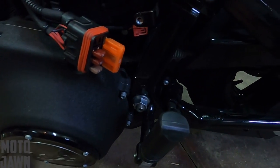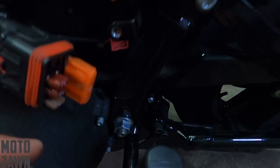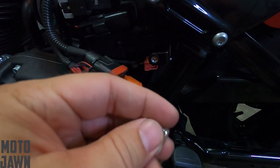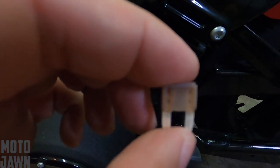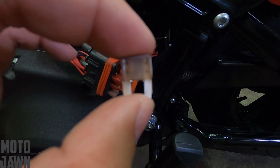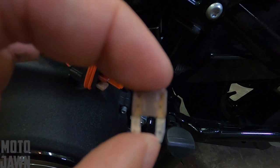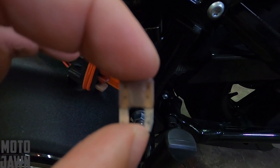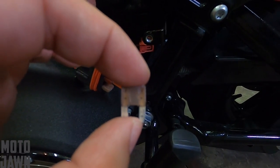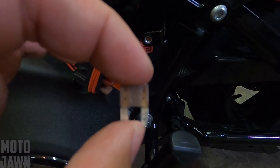So for me, what I found is when I pulled out that five-amp battery fuse right here — this brown one — we can take a look at it. This is the exact one that I had pulled out. You're going to want to take a look in the middle. The fuse is going to have a little white zigzag element in there. And if you can see, it's blown — it's going to be disconnected. You're going to see it's blown and the element in there is not connected. That's how you can know this thing is blown.